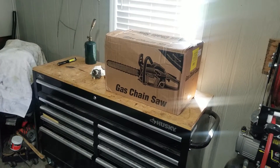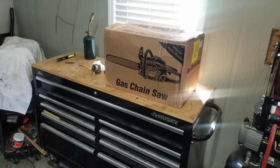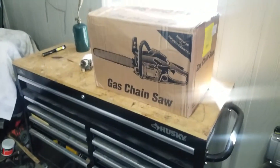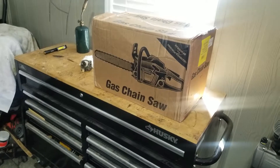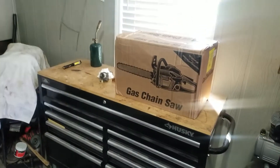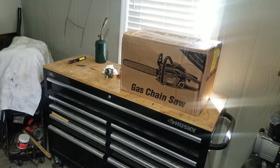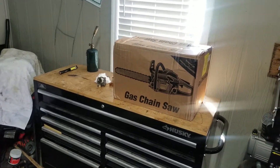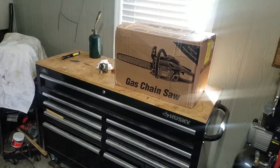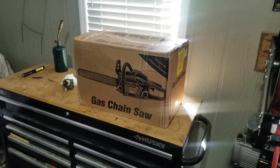When I got done with it I could throw the saw away if I didn't like it or whatever. This saw I bought was just over a hundred bucks on eBay — it's a reworked-to-original-condition Poulan Pro 20-inch saw. I've got a little 14-inch Woodshark that I bought from Walmart about six years ago. Every year I pull the carburetor off, run some carburetor cleaner through it, clean it up, tune it. I actually run that true fuel mixture in it and I don't have any problems. Keep a good blade on it, keep oil in it, and it works fine.